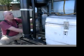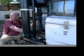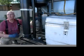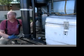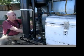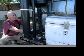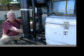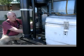I'm going to open this valve. Normally what I do is I drain off about 10% of the tank, which is two gallons. This fuel is being refiltered from my fuel tank, so it's had most of its trapping done already, and I'm just going to draw off a half a gallon. It's been sitting in this tank for two days — can you tell by the color of it when you look at the sludge?